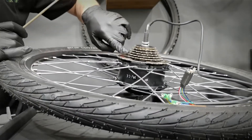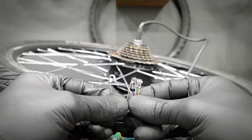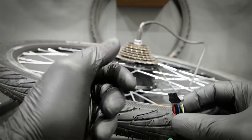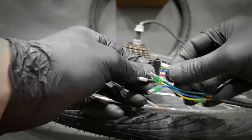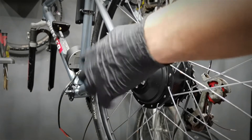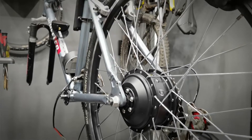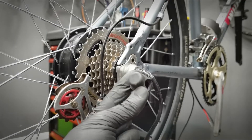The freewheel is being tightened when we put the chain on and pedal. I just needed to bend these connectors back. I forgot to thread this one. Check whether the wheel is centered and it sits nicely in the dropouts. Now we can fasten those nuts little by little on both sides. Just in case you forgot about this cup.